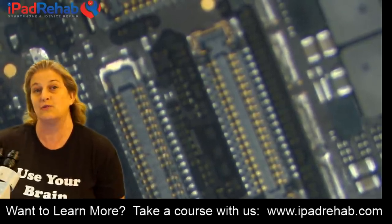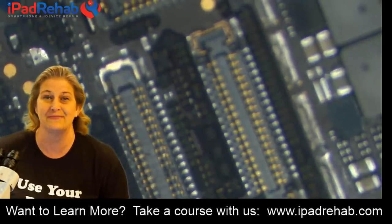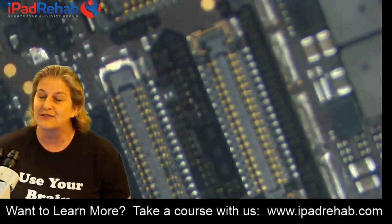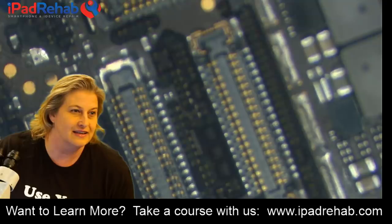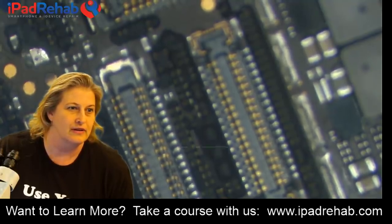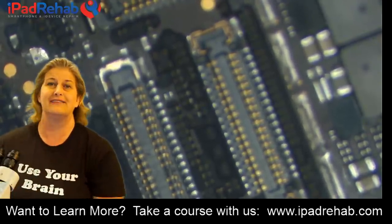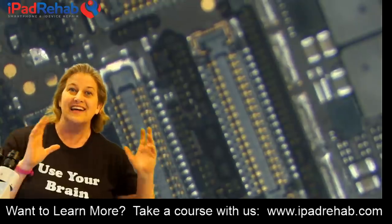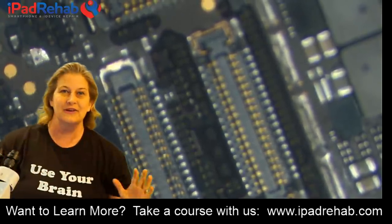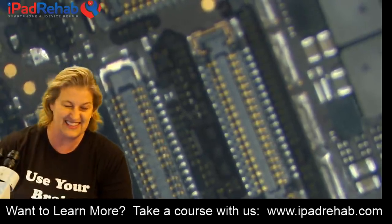That's a big deal because we need to learn how to recognize a dead CPU. Why does this phone have a dead CPU? As we start doing CPU swaps, we really have to understand what's going on at the CPU level. A 20 milliamp reading is the opposite of a short - short means high current consumption. This is low current, so the word 'short' absolutely does not apply here.